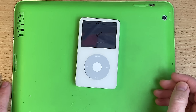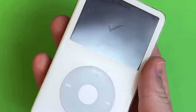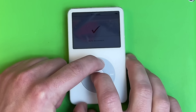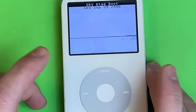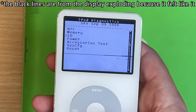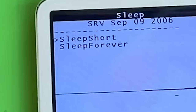When I was doing the one terabyte iPod, I needed an extra command because I was pushing it so hard I had to enter debug mode. It kept corrupting while I was shuffling 50,000 songs and would freeze and say the drive was corrupted — which would have meant another 18 hours of syncing to get the music back. Putting it in debug mode helped: hard reset, then middle and left. And then you're in the weird zone — you can suss out all the weird business.